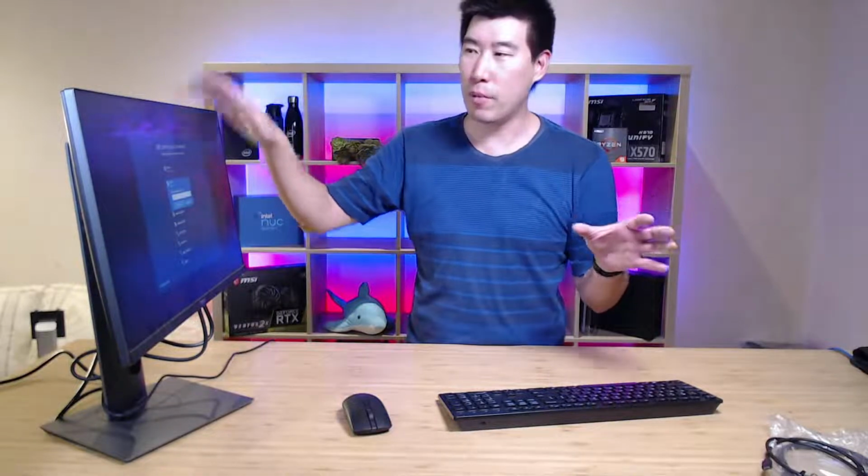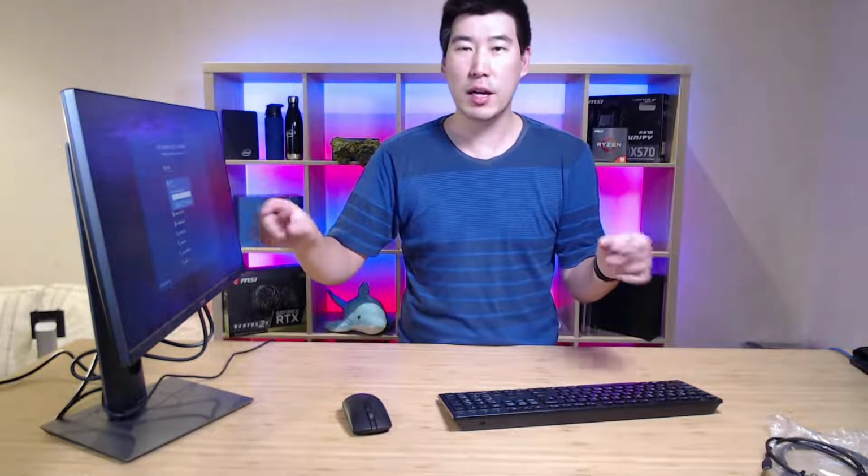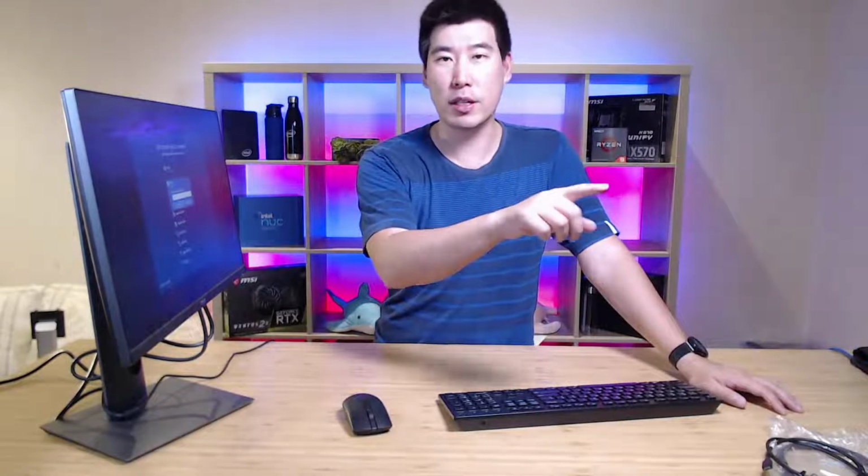Hopefully that makes sense to you. The reason for that is so you only need to have the one monitor connected to the computer, and then the second monitor connects to the first monitor. Therefore, it's more to deal with the cable length. The second monitor doesn't have to have a longer cable, because a lot of times they are a little bit further away, and you'd be stretching the cable. So that's why there's a daisy chain for some of these monitors.